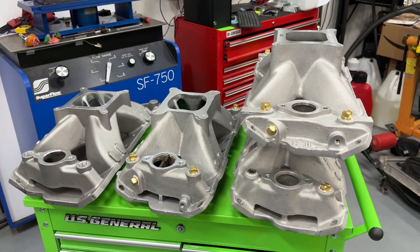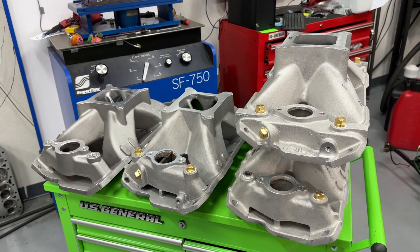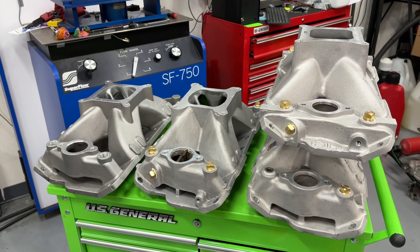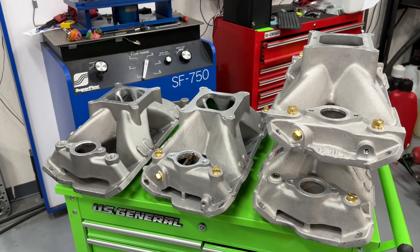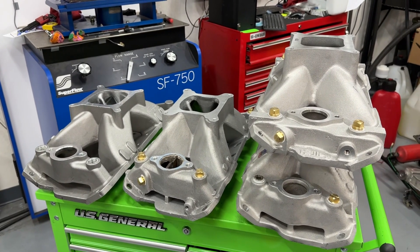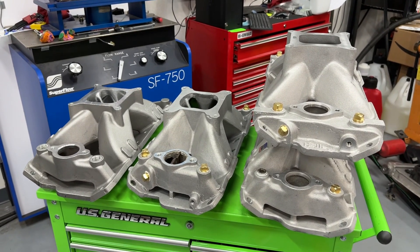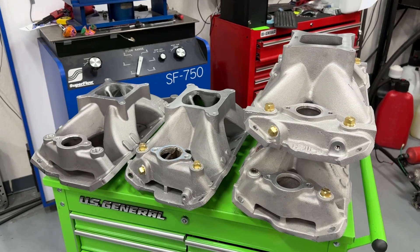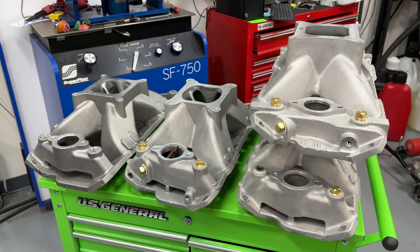The other reason for this test — and this makes sense for several of you that watch my channel — is I kind of want to know how much CFM difference a carburetor makes as far as horsepower. The four-barrel was tested with a 1000 CFM carburetor, and this two-barrel is 500 CFM. The four-barrel I have should flow almost double what this two-barrel does, so will that translate to almost double power, or how much horsepower is lost? Today you're going to find that out.